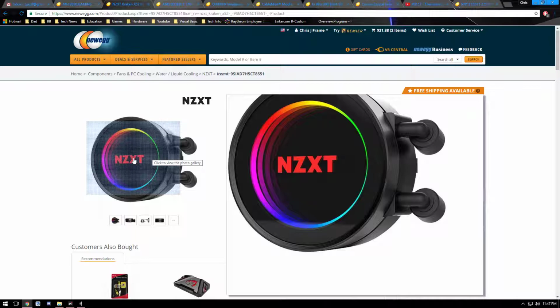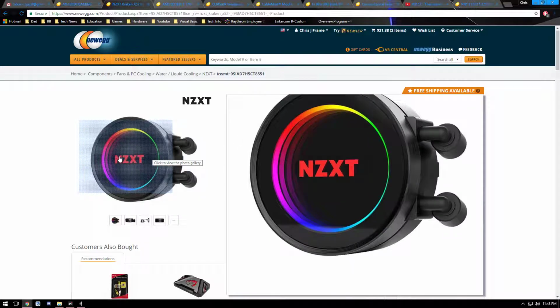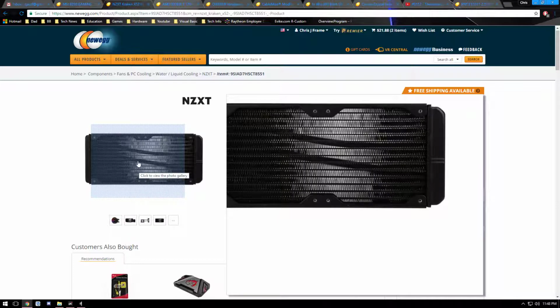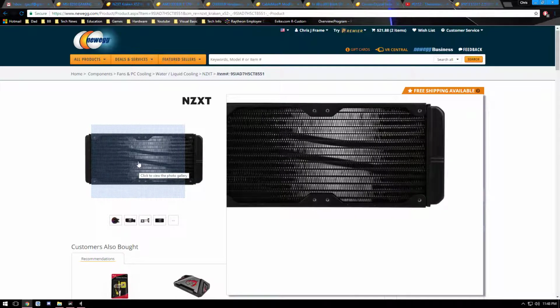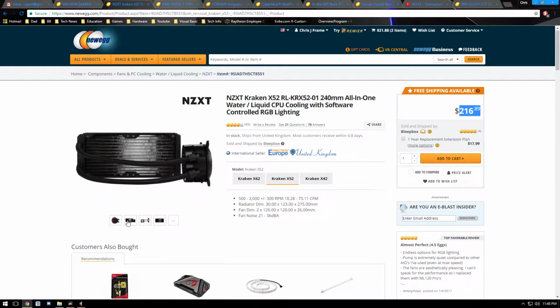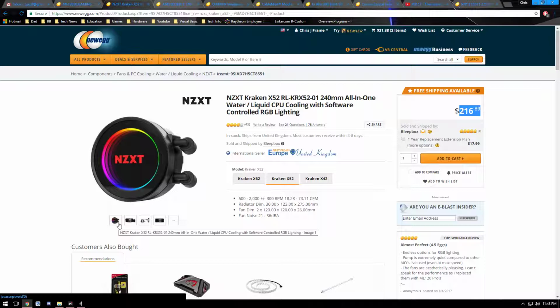If you were going to do any control on your fans and your pump, because a lot of people with liquid coolers set it up for a fan curve. So as the liquid in your radiator, here's your radiator, as this gets warmer, and you have a sensor in there that senses the warmth, usually you want to up the fan speed on that cooler so that it cools that off. You don't want to set it at 100% all the time. It's just going to be noisy. Yes, it'll keep it cool, but it'll be noisy. And we're trying to go for a little bit more quiet. So that's why you set those fan curves. Well, when the app is closed, it doesn't go off of your set fan curve because it doesn't know it. So it reverts back to a default. It doesn't matter how hot or cold it is, it's going to go for a default.